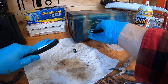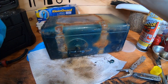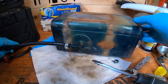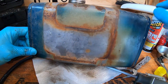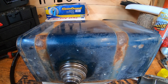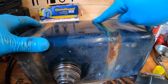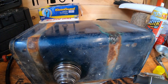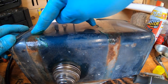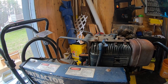We're going to relocate our fuel filter and slide the new gas line on, then put a hose clamp on it. There's some light rusting where the tank bands were, so to help mitigate that rust — this being a pressure washer — we'll rub some light grease where those metal bands wrap around the tank. It's a vapor barrier between the bands and the gas tank, so a little grease will go a long way. Let's finish that up and slide the tank back on.